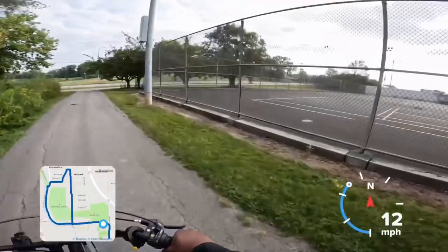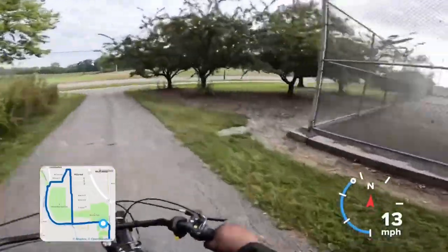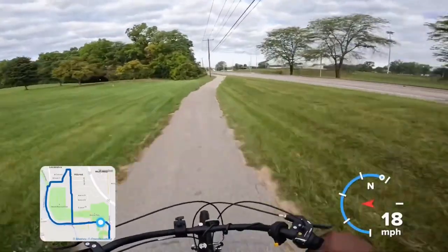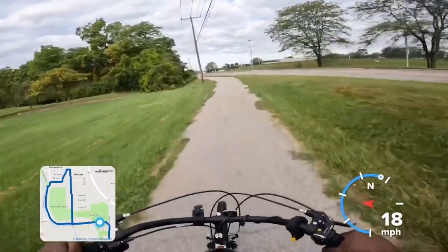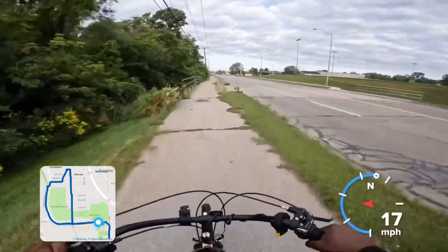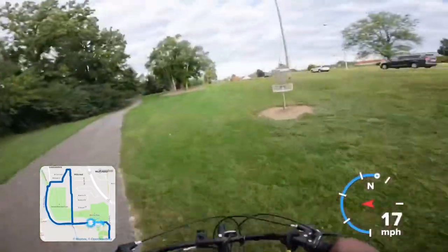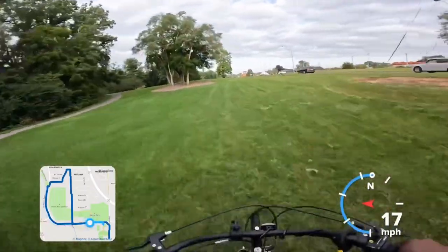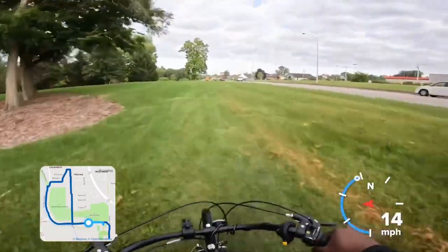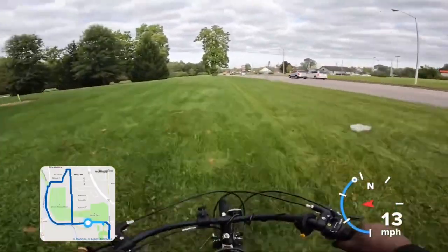Our builder here decided to go with the 4-stroke, which is fine. It sounds like it's running well, but I wouldn't recommend it for new builders for the reason he ran into, which is the same thing I had to deal with on my first build. You have clearance issues with the cranks, so you can't pedal it unless you get a wider crank set. Installing the adapter for that on a Cranbrook is okay if you really know what you're doing, but it's a nightmare if it's the first time you ever tried to do it.